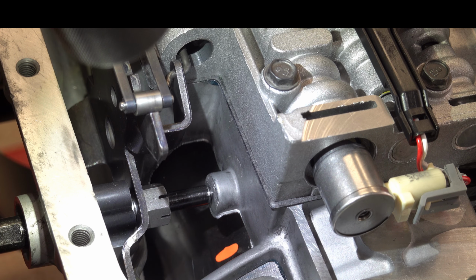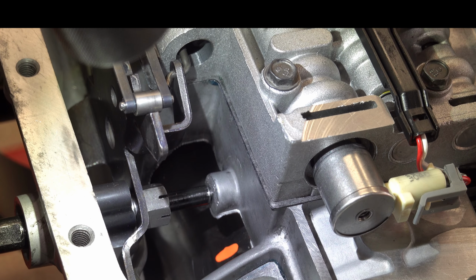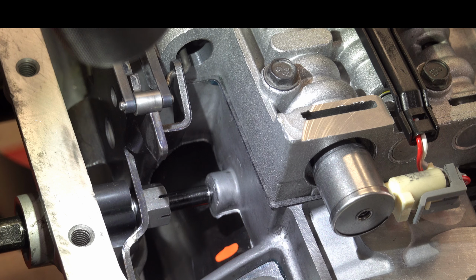All right, that's about 1/8 to 3/16 of an inch. It's markedly less than it was prior, and it's not quite as tight as it was when we simply put the two shims in there without doing anything to the pin as far as grinding. So I'm happy with the way this has turned out. We have 50 to 55 thousandths of inboard travel in the servo.